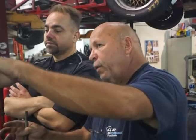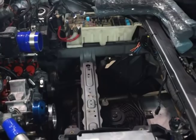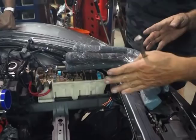So what I want to do is, you're trying to set this up for a kit. A full on kit. Yeah. Drop in kit. Plug and play kit. Out the door. So to make the kit, what is it that you actually had to manufacture? Oh yeah, a bunch of stuff. Okay, so you did have to manufacture a bunch of stuff. The engine mount to the cross chassis member kit. Okay. The custom counterweight and front cover of RX8 modification.